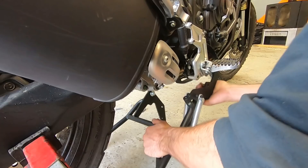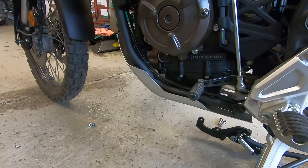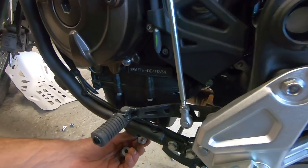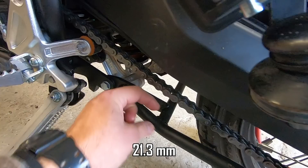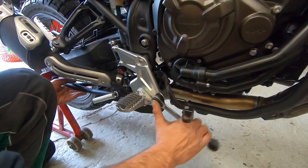It is actually a little bit easier than the original stand — two bolts on that side and two bolts on the other side. I need to remove the engine protection guard first. The two bolts need to go through the frame with spacers on the rear side, and then on the spacers we can add the stand. The difference between this and the Yamaha stand is that this has much thinner pipes — I think 21 millimeters — with a pipe thickness of 2.6mm. But this is not a crash guard, this is a central stand, and I see no reason to make it so big and heavy. This is just to hold the weight of the motorcycle itself.